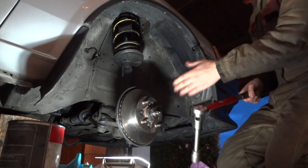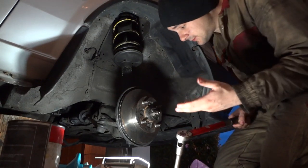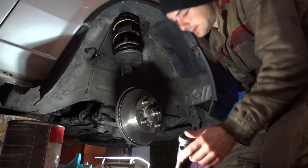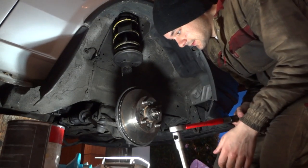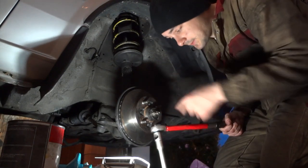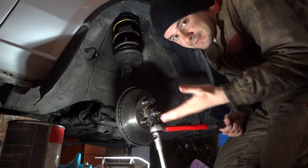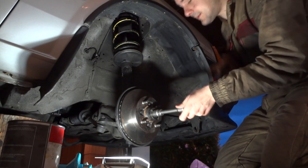If you do not tighten this the adequate way with the appropriate torque, what happens is you'll have premature bearing failure that can cost you money. The money you will spend on bearings, just one bearing is enough to buy a torque wrench, or at least one or two bearings, because this adjusts both bearings. So buy the torque wrench, because you will save money in the end.